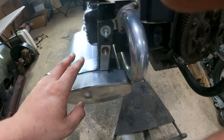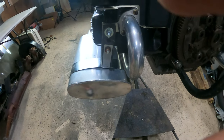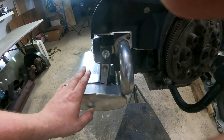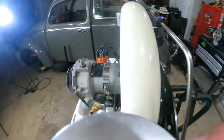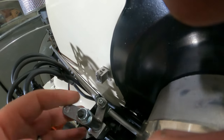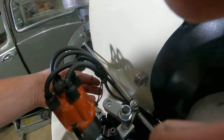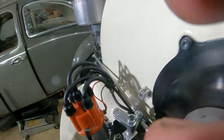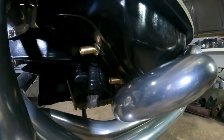The muffler is hung with the included hanger so it's not bouncing around causing a leak at the flange later. Here's the back of the roller throttle tube with Teflon in it, and on the other side there's a little roller wheel that takes the tension off the cable so hopefully we won't pop a throttle cable. I do need to tie the wires back a little and extend the coil connections — just a little too short, but easy to fix. And then we'll get the full flow oiling plugged in when we get the motor in the bus.